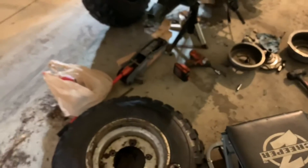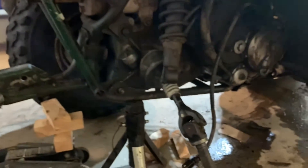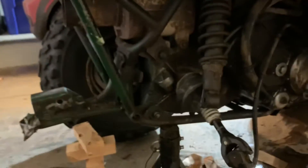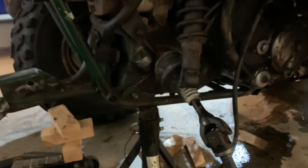I've been watching a lot of Schneid's videos on his King Quad, which has helped a lot. This right rear wheel — the brakes weren't working, so I dug into that, and at the same time I found the wheel bearings were also loose. I also replaced both rear axles with used ones, but I have some rebuild kits from leftover parts, so we'll see how that goes.